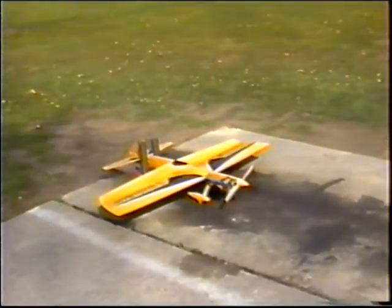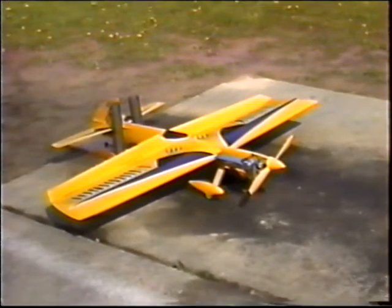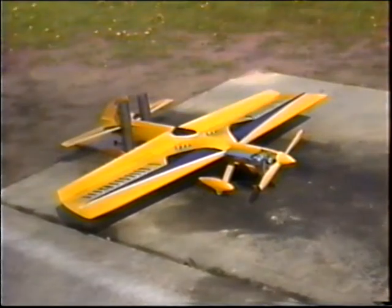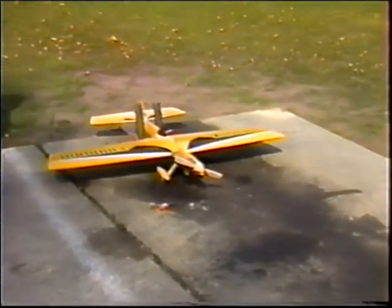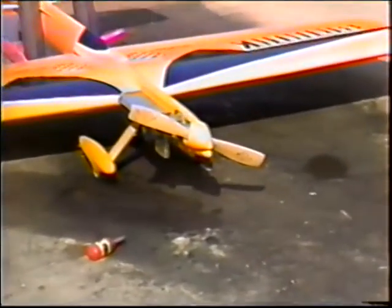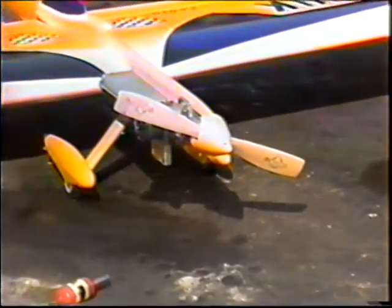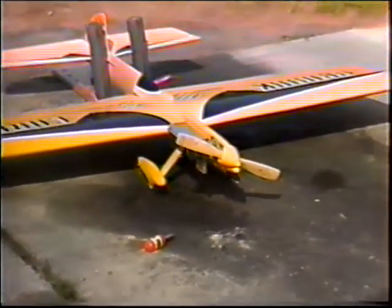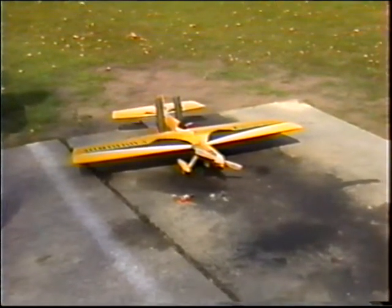But right now, what we're really interested in is getting some testing on this, and as always, the first thing is to get a square one going. The next step is this prop I have cut down to 11 1/4 from a 13-4. This is a really wide blade out at the tip. Before I start playing with the mufflers, I want to get a couple of runs on this just to see if it overloads the engine. I'll go home and cut 1/8 inch off the blades.